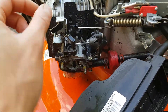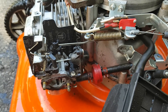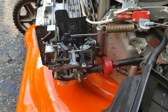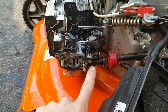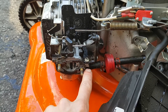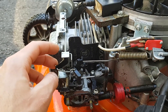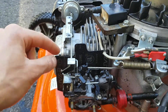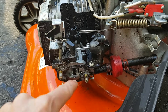First of all, there's a fuel filter which is hidden — they stopped putting these on machines because nobody checks them, nobody knows they're there. You get fuel issues and that could be why it doesn't start. There's also oftentimes a secondary fuel screen inside the fuel inlet which you need to check. When the machine is cold, there's a thermostatic coil in here attached to this linkage which holds the choke closed.